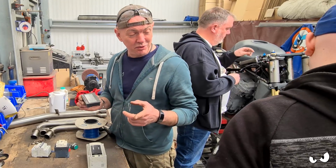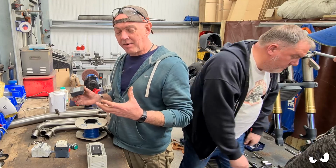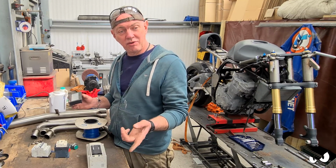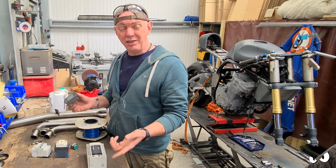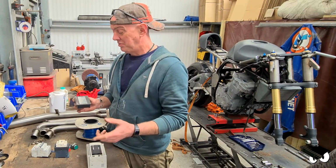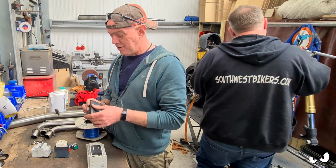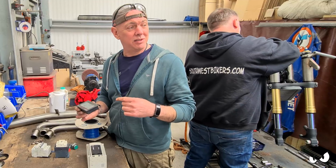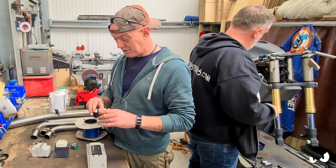And apparently the same sort of philosophy will work on the mill too. So I'm just going to get it up and working on 240 volts to start off with. But at some point I could stick a 3-phase motor in, run an inverter on that. I don't know what it's going to be like on 240 volts, so that's the thing. It might be fine. If it is fine, I'll just leave it because I've already got the motor. But if not, I can put it back to 3-phase without having 3-phase plumbed into the shed, because that was stupid money. That was properly crazy money.